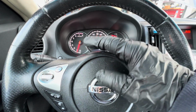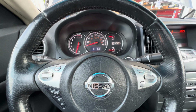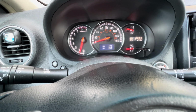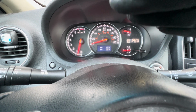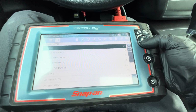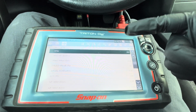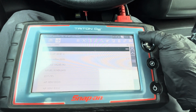Now you remember before when I gas it up and then let it idle, kind of drop down the RPM. But since I replaced the part, everything breathes better. You can see I'm gonna rev it up, and then the needle still stay the same over 600, and it doesn't drop. See how it stays steady over 600. So that's good. I'm gonna show you the data again before, with all the bad engine air filter, the dirty throttle body, bad mass airflow sensor. Now you can see I'm gonna rev it up, and before it drops down to like low 400 RPM, and you can see it's still staying at 600, so it's good.